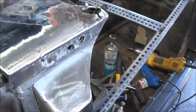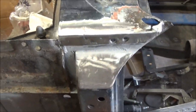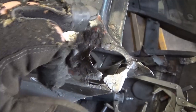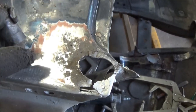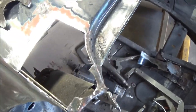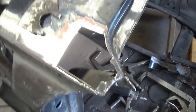The new flange is in place, welded in and plug welded — everything is cleaned up, nice and solid. We'll move on to the last repair piece of the top panel here. I'm going to try to keep some reference — try to keep the half-moon piece since it seems fairly solid — and then we'll replace everything around it. We'll cut out a big square back here and attach it back to the half-moon piece. We've got that area cut out now and the old piece removed, so we'll fabricate up a new piece and weld it in there. Taking a quick break now.